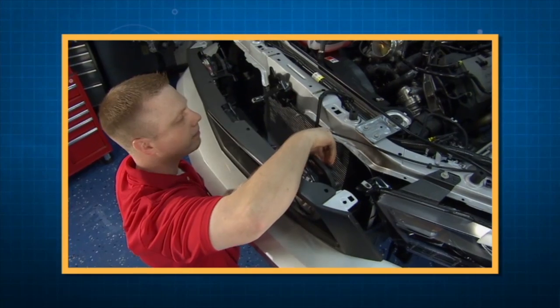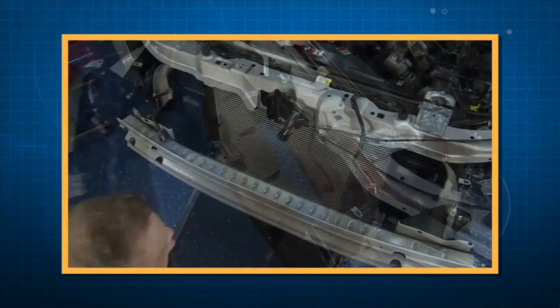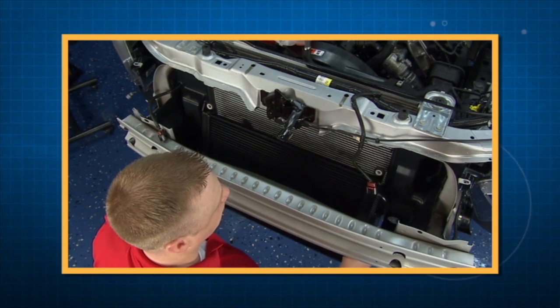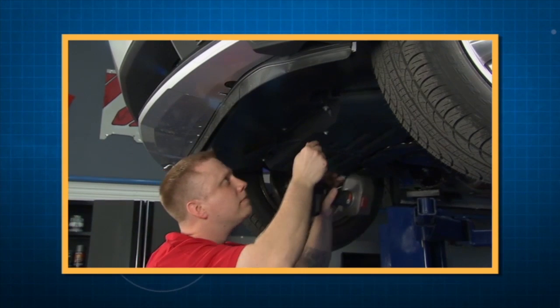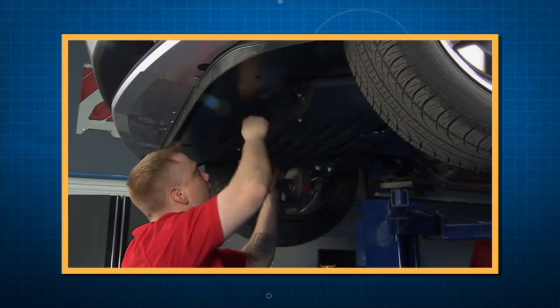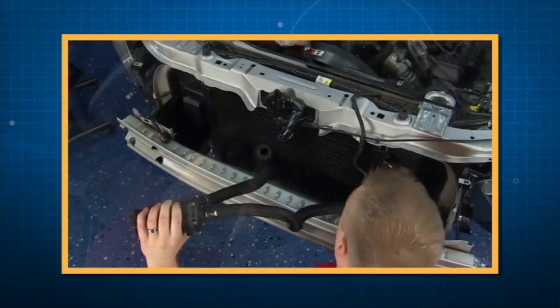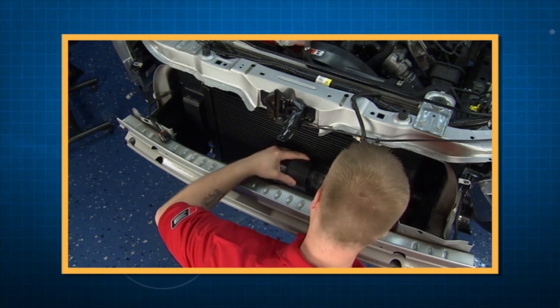With the fascia off, after taking the fascia off here, couple bolts, couple push pins, we start with the intercooler install. Now we got the lower fascia off the bottom, or the air dam. Get that out of the way because we're going to be making some messes on our path to getting the supercharger on. Now you got your whole pump and intercooler up here. That's going to cool that hot air that we just compressed with the supercharger. So we got cooler, denser air going in to make a lot more power.